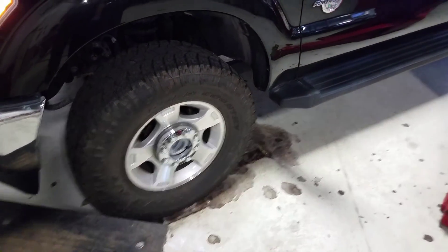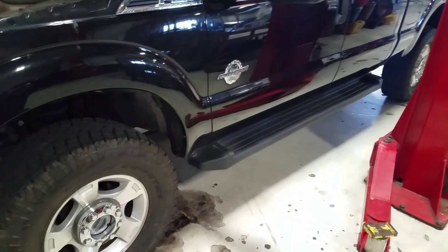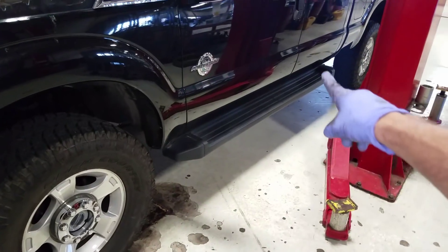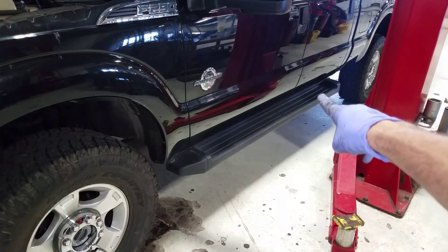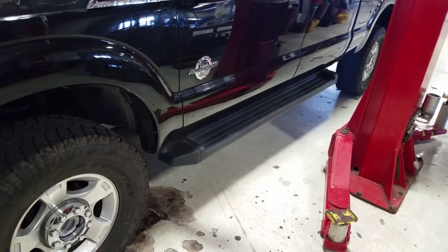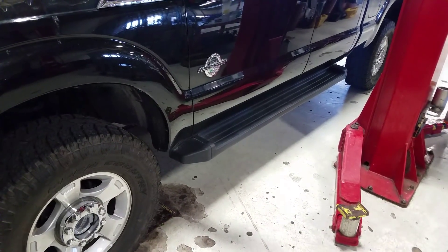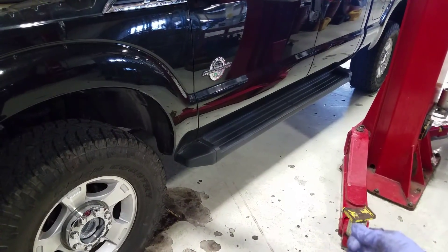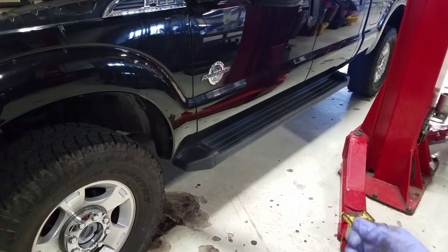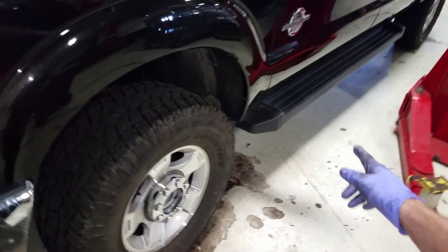This vehicle came in for some maintenance and I've already gone ahead and completed the maintenance, rotated the tires, checked the brakes. I've already replaced that fuel filter and have turned the key on six times, each time waiting 10 seconds between key off and then key on, letting the key stay on for 10 seconds. That's the first fuel filter you do.